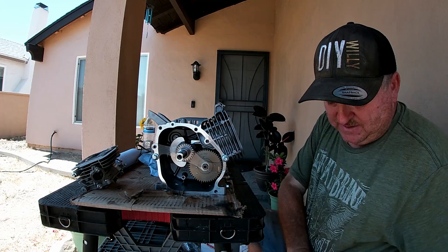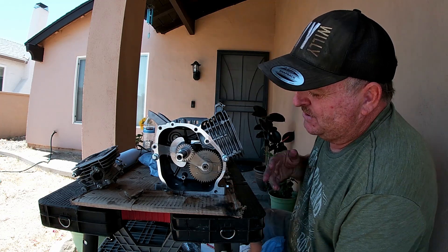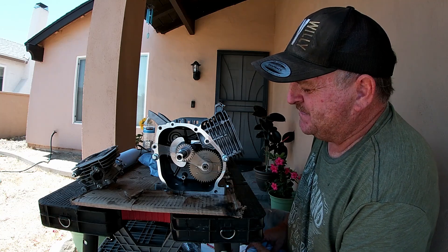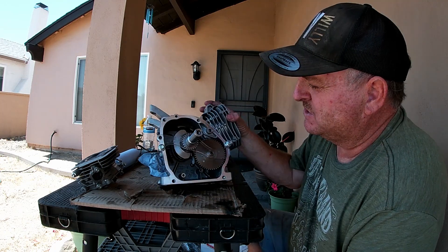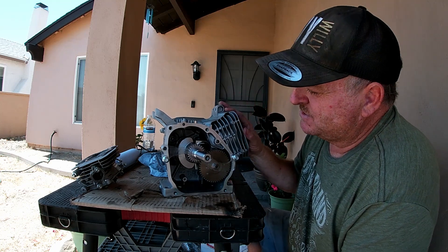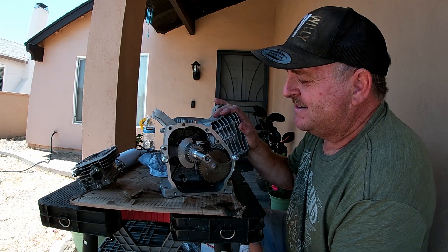You know it's just a small engine - these things aren't balanced or nothing like that really. I'll take a little bit off the rod and I'll clean up the crank a little bit. Then we have to wash this engine out really good to get rid of all the metal shavings that are floating around - this and the head both. So that's all I've got time for today. I'll come back at it again in the morning when I have more time. So we made good ground today - clearancing the block, getting the crank to turn, and starting the clearancing on the cam. We did for the most part get it to turn but it's just touching a little bit, so I'm going to go ahead and grind it out. We'll have to do that tomorrow - so I'll see you guys tomorrow.